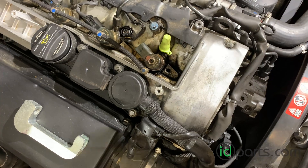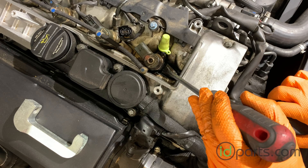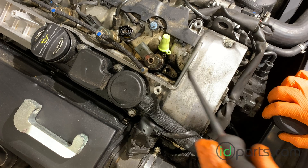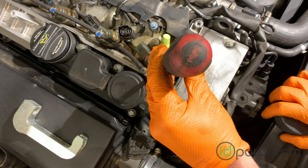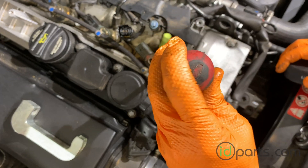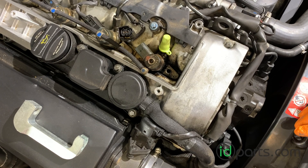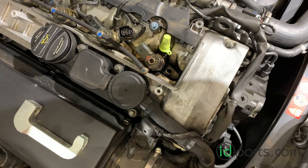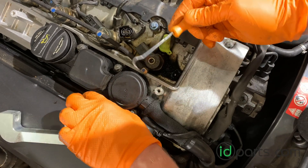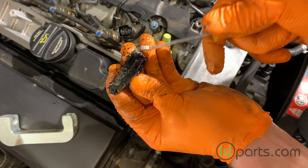Again, be really careful — cast aluminum, don't pry against it or this job will get more expensive. If you must pry, use a flathead screwdriver and get it between the injector body and the hold-down clamp. The injector is pretty much hardened steel. I'm using a hockey puck and my hand — very gentle — and that should push the hold-down clamp free. Pick tools are your friend to work through this hard buildup.